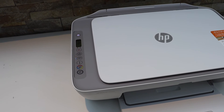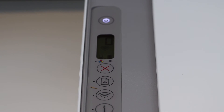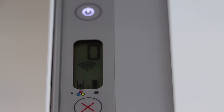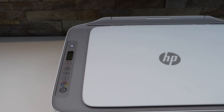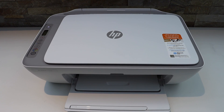Go to the printer screen and wait for the ink cartridges to start normally. Here we can see the error is gone and the flashing light is gone as well. This way we can bypass the setup ink cartridges and use our normal ink cartridges for wireless printing and scanning in the HP DeskJet 2700 series printer.